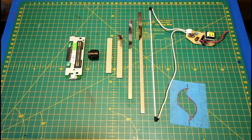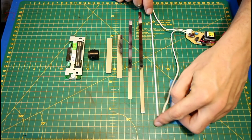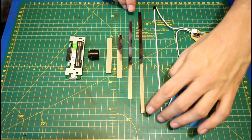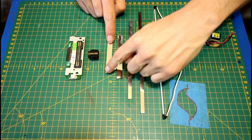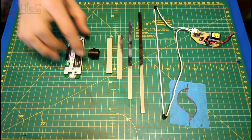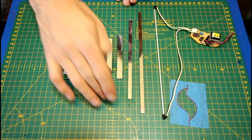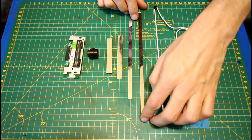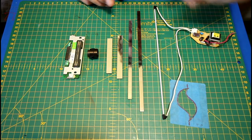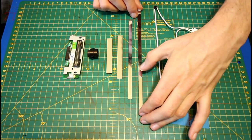and I can show you what the pieces are. So here we've got the optical assembly for the scanning head. We've got the CFL bulb, the driver for it, shining light on the page, which bounces off this mirror, then this one, and this one, and this one, through this lens, and onto the sensor here. And this was what was converting the light from here to here, that's why these mirrors are smaller. I thought you'd need a bent mirror to converge the image down, and you could do that, but it'd be harder to do, and probably more expensive and awkward and everything else.